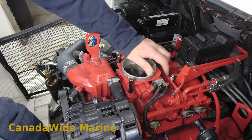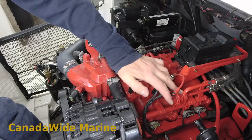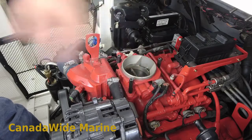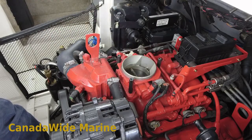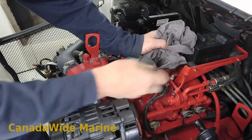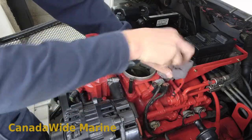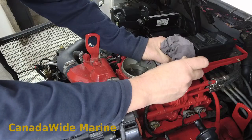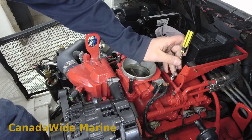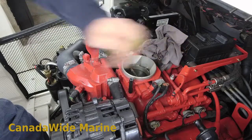It's just like a tire valve with a little button in there. When you push that button, if your regulator is blocked, you can have up to 100 psi of pressure in there — I've seen 100 psi in there. The fuel will come out pretty hard but not a great amount, because it's a hydraulic system. I just put a rag over the top of it and use a little screwdriver to bleed the fuel pressure out. I haven't run this motor for a couple of weeks since I hauled it out, so the pressure is already bled off — no pressure in there, which is good.